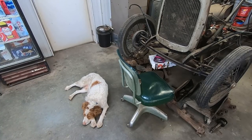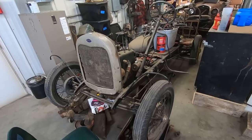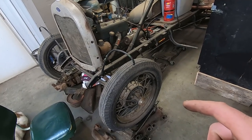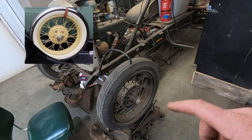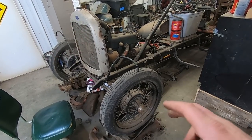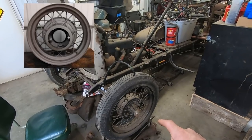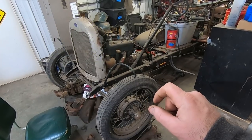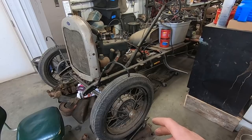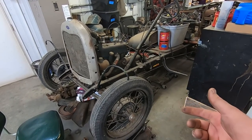This is stuff you should need to know. So this right here is a 29 Ford chassis. If you've got wheels on them, the easy way to identify them is wire wheels. The early Model A's started with the biggest wheel — 21 inch wire on the 28-29 cars. The 30-31s have a 19 inch wire. The 32 Fords have a one-year-only 18 inch wire wheel. 33 and 34s have 17 inch wire wheels. And then 35 has a one-year-only 16 inch wire wheel.